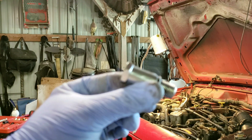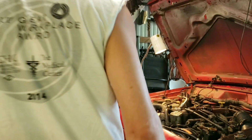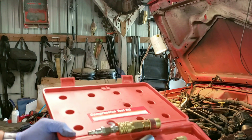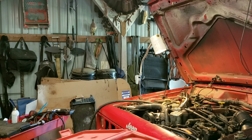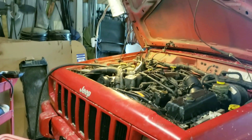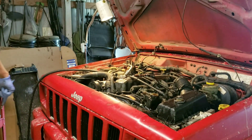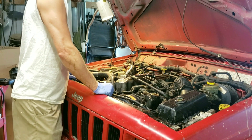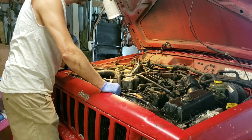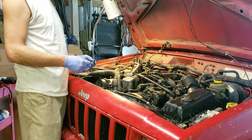So I had one of these in the kit. I had to make sure this fit down in the cylinder — where the spark plug goes. You got different attachments here that you can use to go down into where your spark plug goes. I had to take the spark plugs out one at a time, looking at it. It's usually, from one of the videos I've seen, right in the middle. So I just took out — this is an inline six — I took out number three plug just to check. And when I took it out, I seen water in it.